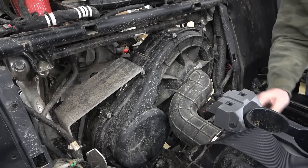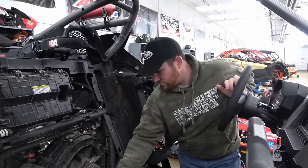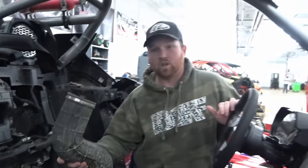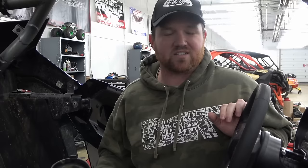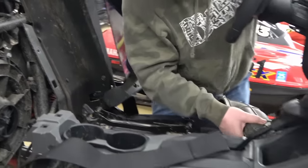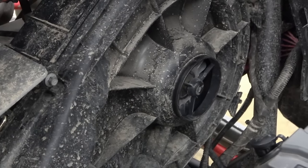Typically it's on the side of any other Razor, but on the Pro-R the engine is mounted longitudinally, so all the clutches and stuff are on the front of the engine, which is technically the back — it's very confusing. At first when we first saw this design it was like, man, this kind of stinks, but these are really good on belts. These clutches work really well in these machines, partially because of that tube you just took off — it actually feeds fresh, cold air in from the hood all the way back onto the secondary clutch.